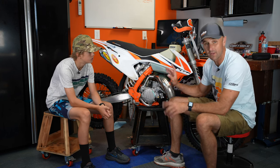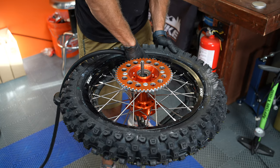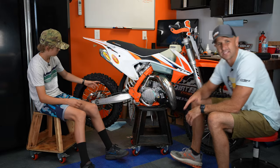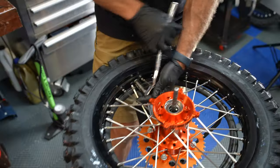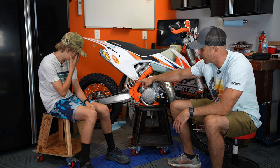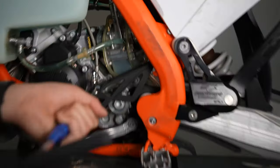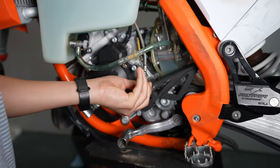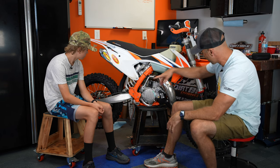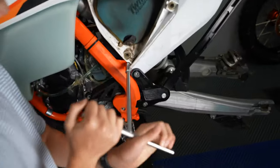I've got a second 85 for my younger son Case, who's 11. We went with the KKE racing wheels — the biggest reason I did that is because they had a complete wheel set for front and rear. We then went with a Tusk rear brake rotor, a Primary Drive sprocket — it's a 49-tooth sprocket — and a brand new 13-tooth front sprocket. So we've got brand new sprockets front and rear, brand new chain, brand new brake discs on the front and rear, new hubs, new wheels, new tires, and heavy-duty tubes.